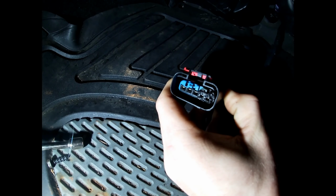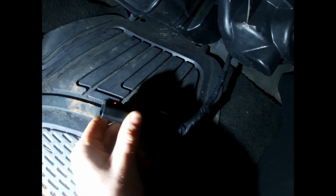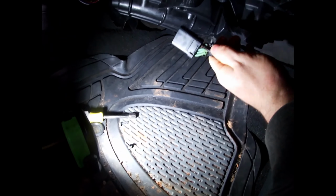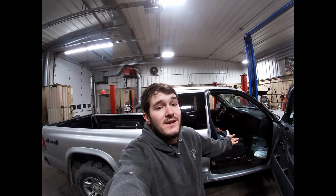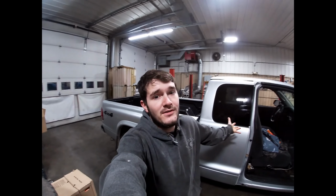There's the inside of that electrical connector, just fried inside of there. That's gonna have to be replaced for the pigtail as well. All right, guys, well that pretty much does it for now. We're gonna give the customer a call, see how they wanna go about this. I know that these have been replaced before, so this green wiring is definitely not factory. That sure looks like some Dorman stuff in there. So we need to get a hold of the customer, see if they just want to warranty out for more Dorman stuff. This may happen again with the other stuff, or we'll just let them know that, hey, we may need to put factory stuff in this to stop this from happening. So I'll get back with you guys when we find out what they want to do.